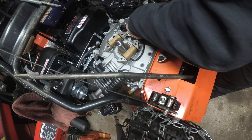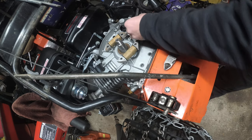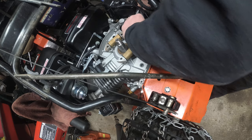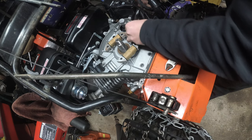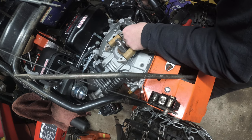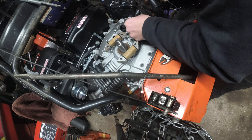We'll get these hanging out the voltage regulator. Hopefully, yeah, we have enough that sticks out. So now I'm just trying to see if I could pull out the appropriate amount of wire. I'm just fishing it through my cluster of wiring, and I want to have some slack, but I don't want to have much, because like I said, I don't want anything to get caught on that flywheel. So that's going to kind of be where we're at.